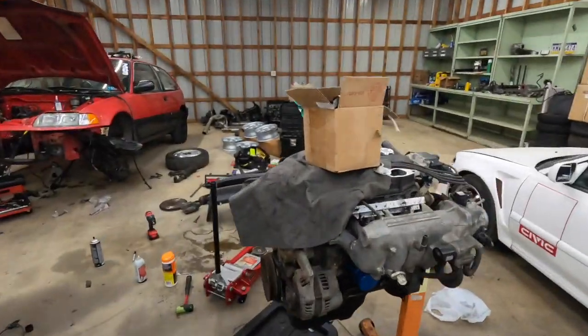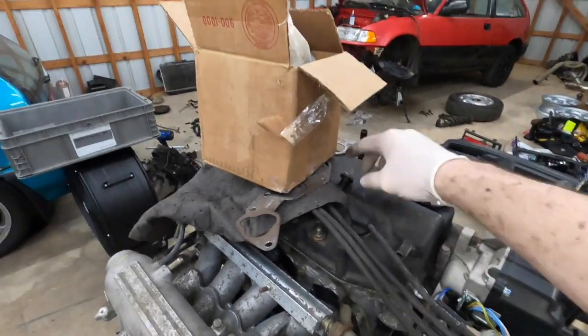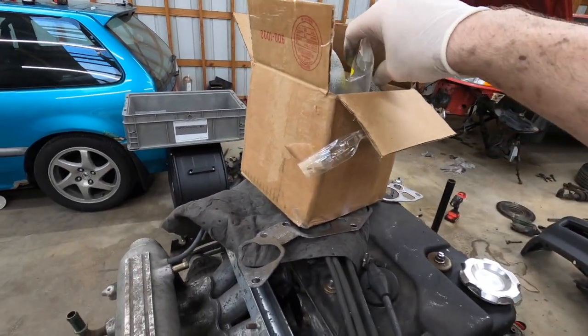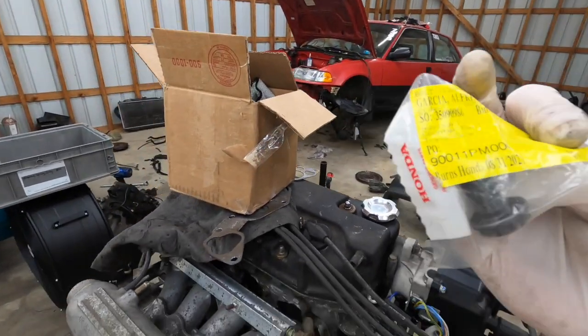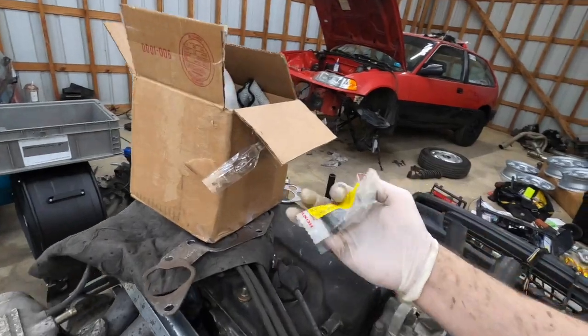Yarrow and Frito should be here soon. So that means we can start diving in and getting the B2 cam put in this. Also, that flywheel bolt that was damaged. So Honda uses the same flywheel bolt in the Fit. This is the same part number and the same length, everything. So the Honda Fit uses D series flywheel bolts, which is nice. Honda does know how to repurpose stuff. Everything can be used on other stuff.